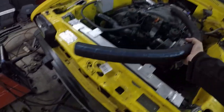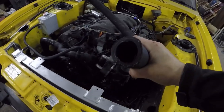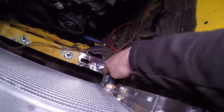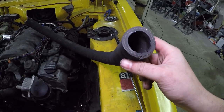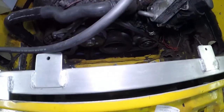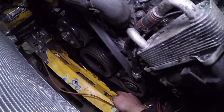I've got this 35mm wire hose — it was actually cheaper than normal stuff, probably a pricing error on eBay. It's a bit tougher than I expected, but it is designed to bend with a nice tight radius without kinking. Despite being sort of plant spec, we might make it work. The idea is to try to get the hose from here all the way down to the fitting at the bottom. I did buy some P-clips for it but didn't anticipate the hose being that big, so I need even bigger P-clips. I've already cut out some of the bits down here and we'll probably seam-weld down the bottom instead.